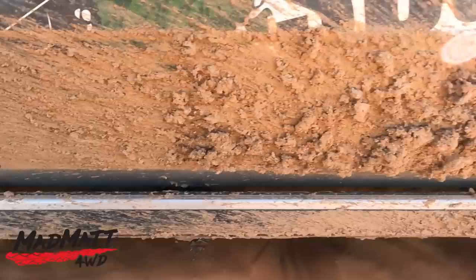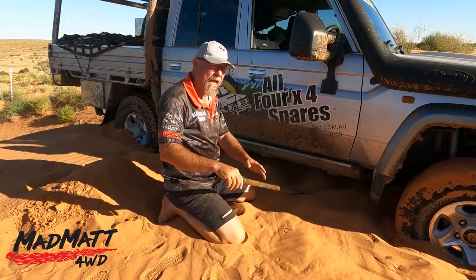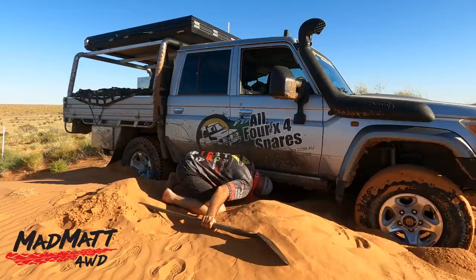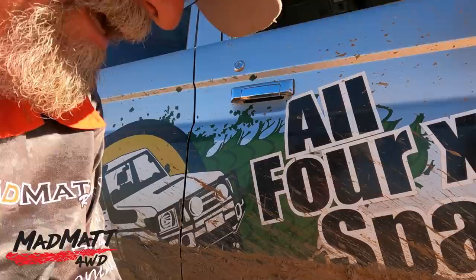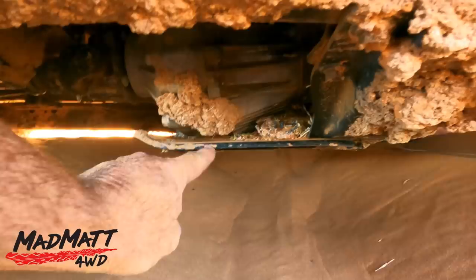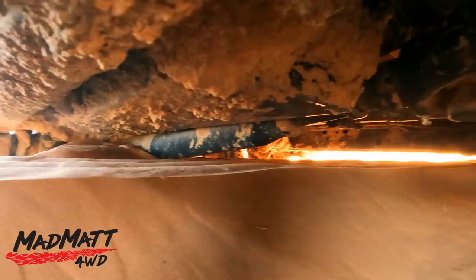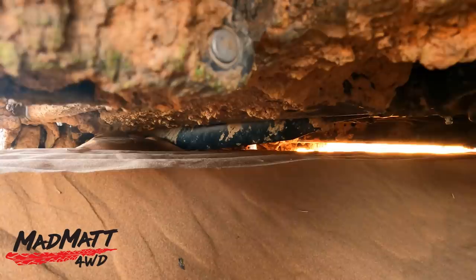Look at all of this just sitting hard on the sand - so we're going to free that up a bit. That's going to be fun. So what I'm going to do is dig a hole here because that's easy to dig, and then I'll pull the sand that's further in into this hole. I'll show you what we're looking at now. Under the transfer case we've got plenty of clearance - that's not hanging me up. But let's go to the back - look at that. Everything's sitting on sand, and that's the problem. When you stay into the power when you're not going forward, you go down. So we'll dig that out and free that up and see how we go.